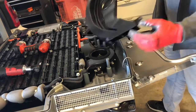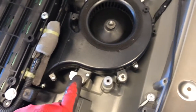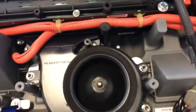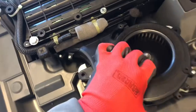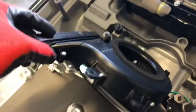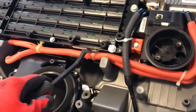This is the duct for the fan coming over here. Now you'll need to remove these 10mm nuts — there are four of them on this side and four on this side too. You can just pry up on the fan and wiggle it out, but before you do that, remove these clips — they just pop out, there's one on each side — they hold the fan into place. Now you'll be able to wiggle it out.